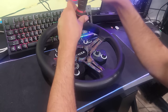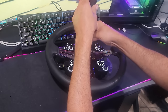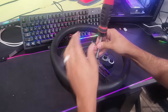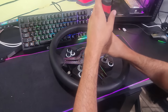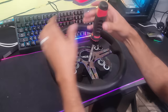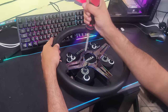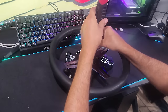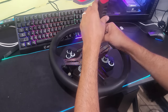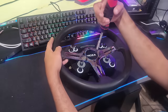I think the neochrome with the black does still look extremely nice. Now we're going to spin these all the way in, starting with the top one and the bottom one just to index our steering wheel on our base. A very simple thing — just a couple things you need to watch out for, like the wiring harness on the backside of the quick release. If you're changing to any type of aftermarket wheel, make sure you get one that has a straight style spoke rather than angled spokes that would hit the buttons. If you're doing a deep dish wheel, it won't make a difference because deep dish wheels will clear all the buttons.